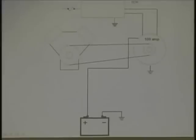I do want to warn you, we will also test solenoids. When we test solenoids, we're going to hand them out. We're actually going to put voltage down there, and you're going to check amperage in that circuit. Now, if you don't know what you're doing with your amp meter, meaning in series is a straight line, not parallel, you can blow the fuse in your meter. We're not going to be responsible for you blowing your fuse in your meter. We'll be more than glad to show you and help you. Does everyone understand that? So when we do that, Basil, you did bring in the power probe? Good man. So we'll get rolling with that.